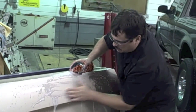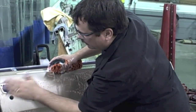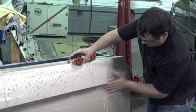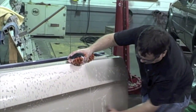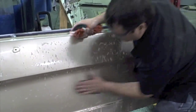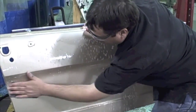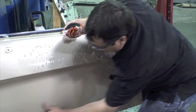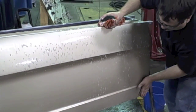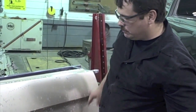It doesn't take long. Just make sure that you do every square inch, because if something's not sanded, your clear is going to peel from there. Make sure your edges are good because the paint is going to peel — it usually starts from your edges. This would be the same thing on your car attached to it; we just have a panel off the car to make it easy to demonstrate. You can sand your whole car with a thousand grit if you're doing artwork on the whole car, or just do a door.